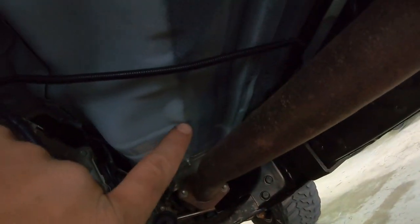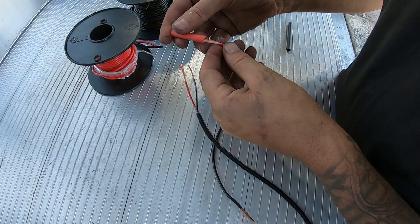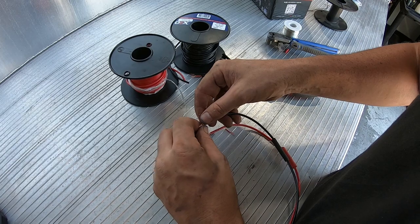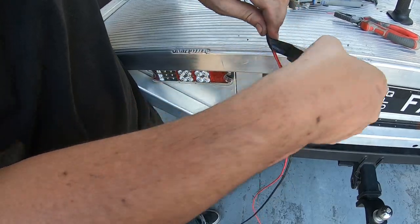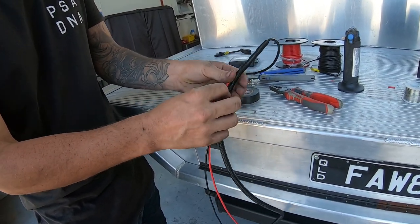This is basically going to be the main hub. The hardest wire to run was the one that had to go across the exhaust — I've tried to pick a nice safe spot and I've just wrapped it in some spiral wrap, which I'm hoping will be good enough. It comes up over the gearbox and goes into the hub, and the other side just follows these lines here.